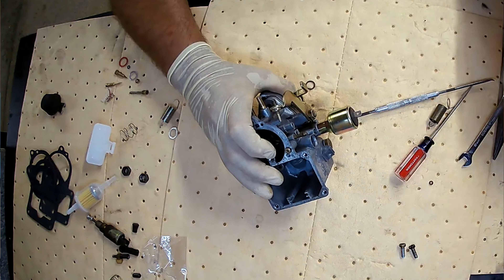Looks like they changed that to a 19. I'll go ahead and hand-tighten it for now. On the bottom, it does have a gasket, so I'm going to put that on and then put these two on just to remind me where that gasket is for later when we install it back on the car. Here's another valve that we do need to replace. Stick that down in there and screw it down until it stops moving, but do not over-squeeze it — just tight and that's it. Now it's time to add our new float. Our old float is pretty ugly looking, but we do need the pin from it. I'll slide that new pin onto our new float and drop it down in there. This valve right here — gas flows in and when the float touches it, it seals it off. That's how we stop fuel from going through places it shouldn't be going.